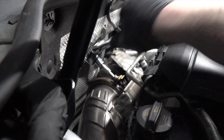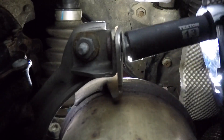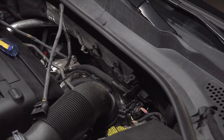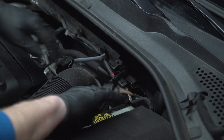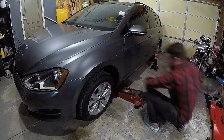Now you're almost at the final step. Go through and tighten all the bolts in the order that the installation instructions for your downpipe specify. The final step is to replace your O2 sensor — slowly feed it in, optionally put a little anti-seize on it but keep it away from the sensor itself, then tighten it up with your oxygen sensor socket. Rewire the O2 sensor harness through all the clips on the firewall and plug it back in. Put the front tire back on and reverse your jack stand process to get the car back down.